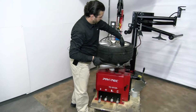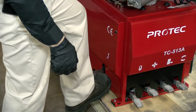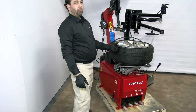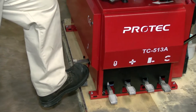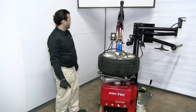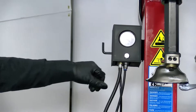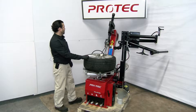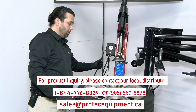Put the valve coil tire inflation gauge on — this has two steps. First step: push the pedal halfway and it'll fill the tire. Push it fully and that'll activate the bead blaster; it's got a built-in bead blaster you can use. Do not go past 40 psi when filling the tire during installation, because anything past 40 psi the tire may explode and you could have injuries. Check the pressure and set it to whatever the vehicle setting is, and that's it — you're done.